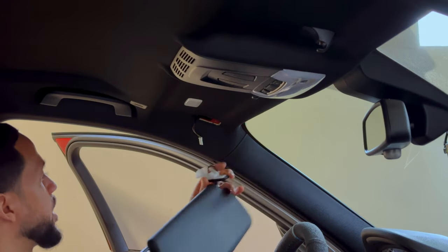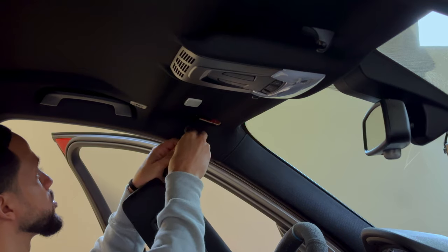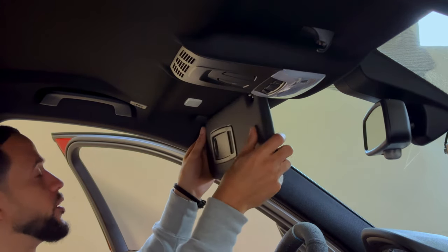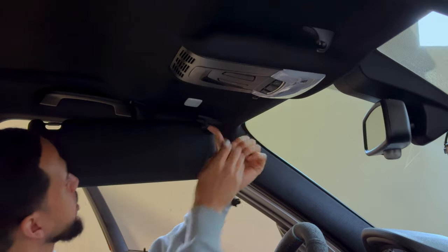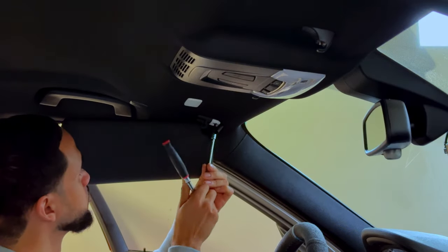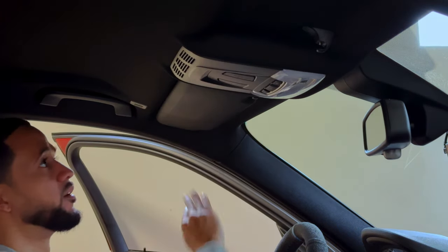Let's reinstall the driver's side sun visor. First, clip the power cable back in, make sure it's snug, then tuck that cable back in. Tilt towards you, hook it in place, tilt it back, then expose where we screw it back in. Oh yeah, that's so much better! For the passenger side, repeat the same steps — connect the power cable, wait till it clips in, guide the power cable up, tilt the visor towards you, let it hook, push it back forward, turn, and it should sit right in place.